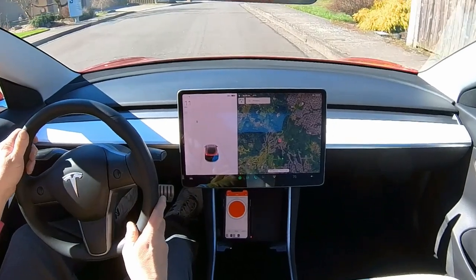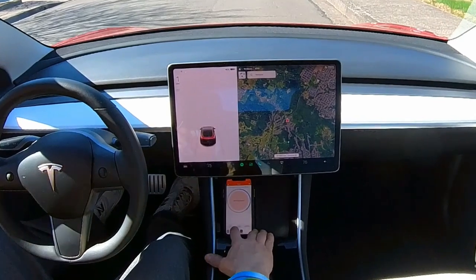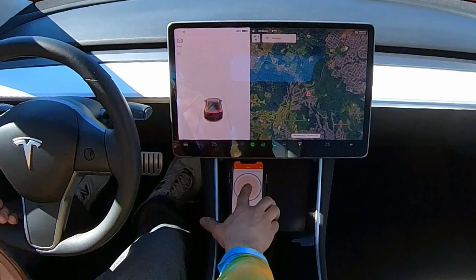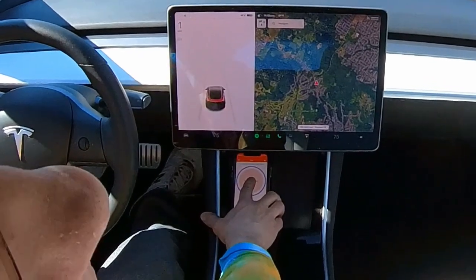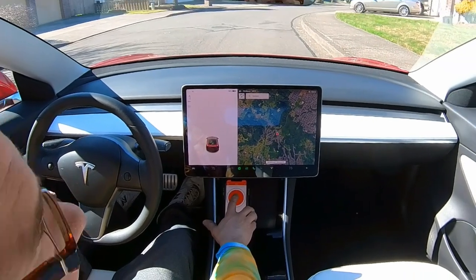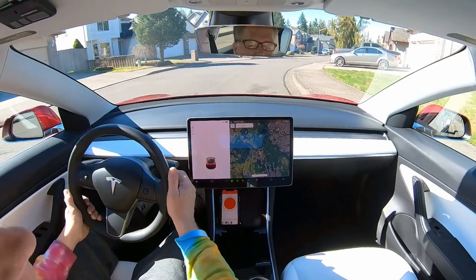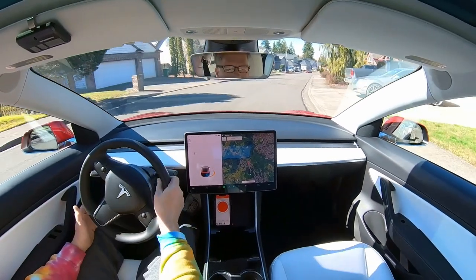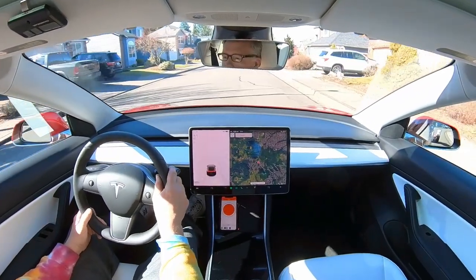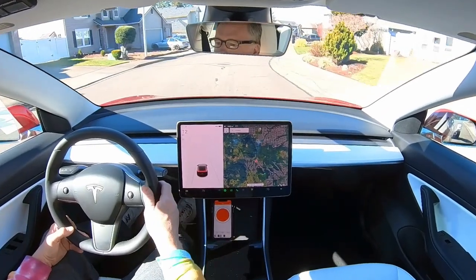I'll pull over a little bit right here and we'll play around with the brake. I got it set to 20% right now. Let's see if it still drags the tires. No, but it stops the car — you can feel the additional drag. It's definitely working there, working perfectly. With no load on it, about 20 is about perfect.